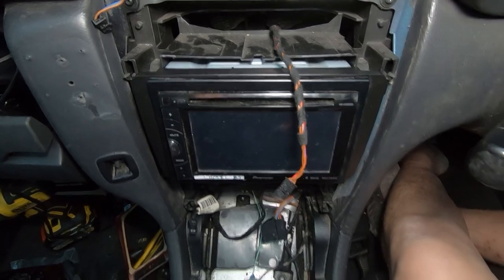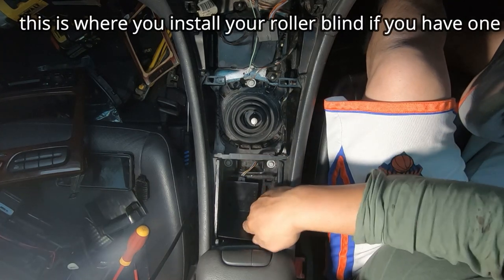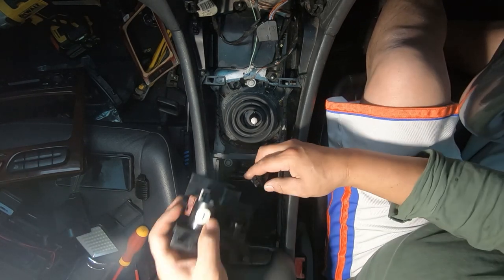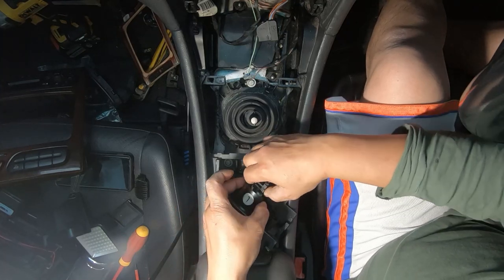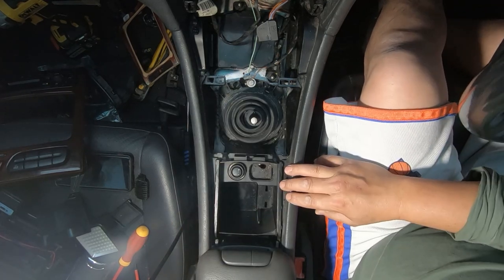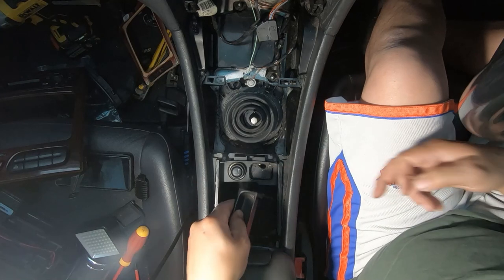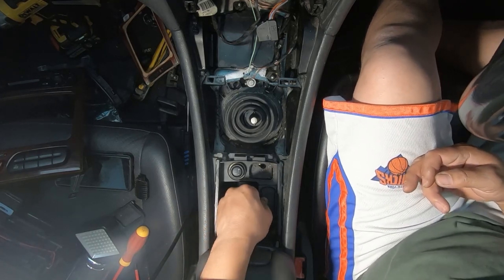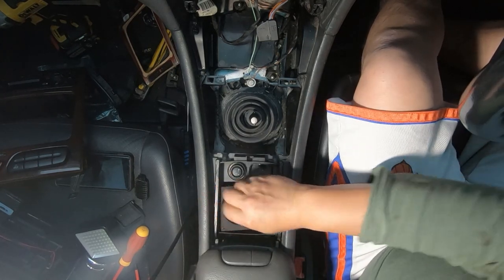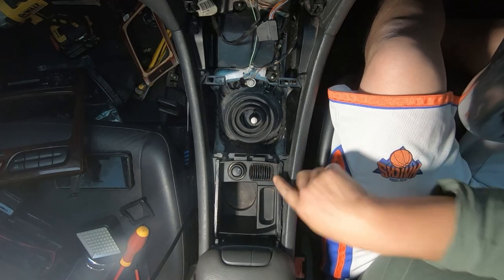I'm going to start by reinstalling everything at the bottom. In order to put everything back in, we need to start with the bottom pieces — so we'll put in our rear piece first. Next, we will put in your cigarette lighter and simply plug it back in. Slide it in on an angle to get it in, then push it back in. Now we can grab our little storage holder — remember, you've got to follow the curve, so come in straight and push it straight down and it will clip back into place. Then we have our cup holder — the thickest part sits at the back so it's level. Then that just sits in. We just have to replace our coin holder — put it in this side first and push it straight down.